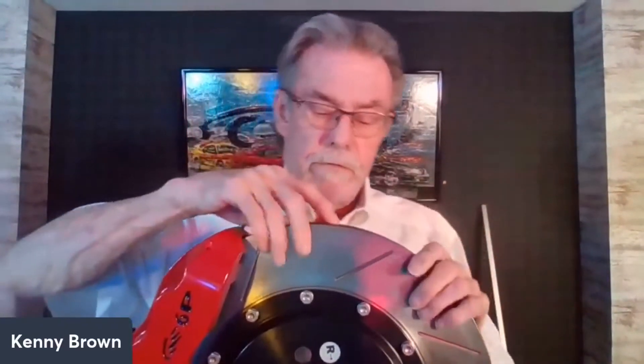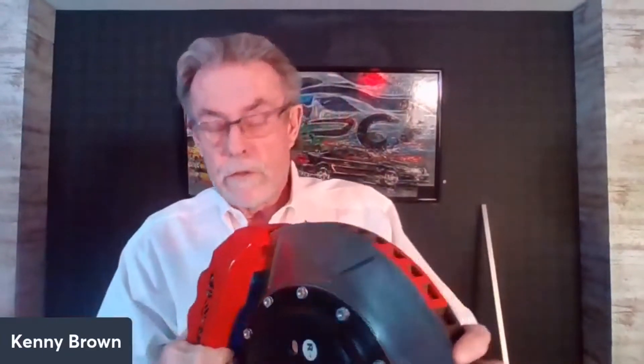It's also important to know that these slots should always face forward. A lot of people think it looks racy to have them pointing backwards, but no — they need to face forward. You can feel the vane going in that direction, so if the slots are going forward it helps vent air because you always want to get air to the eye of the rotor.